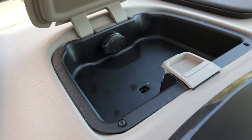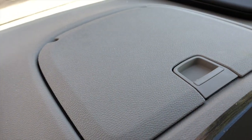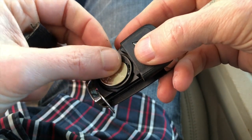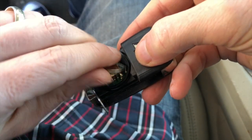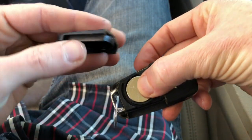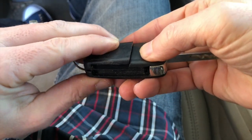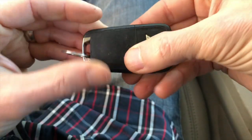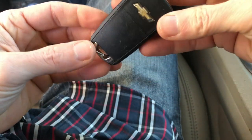So I hope you've enjoyed this quick look at a way to start your Chevy Volt without a battery. You'll see it just slips in there just underneath the edge right there and hits those contacts. Then putting it back on — just have to make sure the battery doesn't slip out while you push that back on. Put the button on and put the key back on.